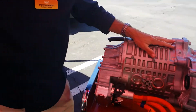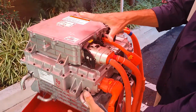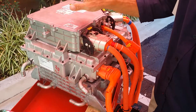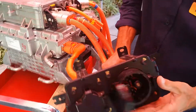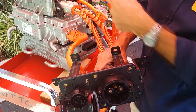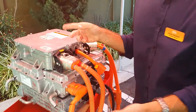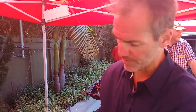What stacks on top of this are a lot of these components right here. This whole array stacks right on top of that underhood space — it's very compact. This is the junction box, where you have energy coming in, literally coming in from the charge ports at the front of the car, and feeds energy into the junction box. And then this basically sends it into the battery, or the battery power comes back here and sends it into the air conditioning compressor or down to the motor. So it's where there's a lot of power coming and going.